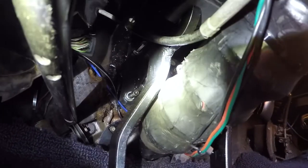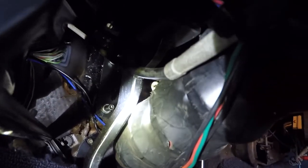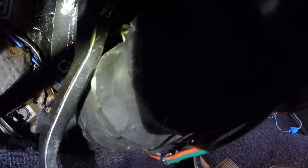In order to get this old brake light switch out of here — it's kind of hard to see, but back up in there underneath, in between the pedal and the steering column above it, there is the brake light switch. It's got a cotter pin holding it in, so we first have to remove that cotter pin.